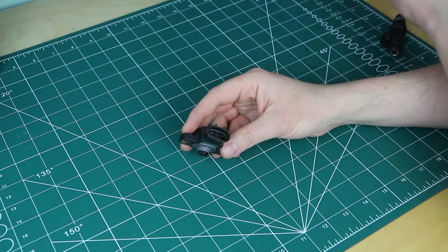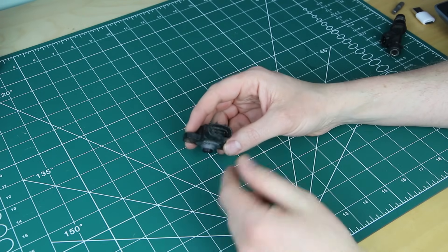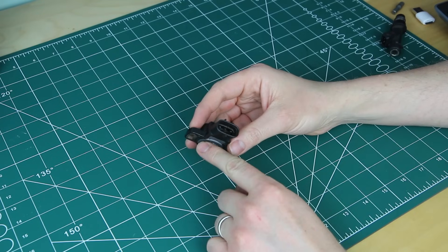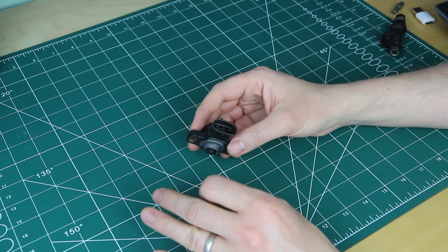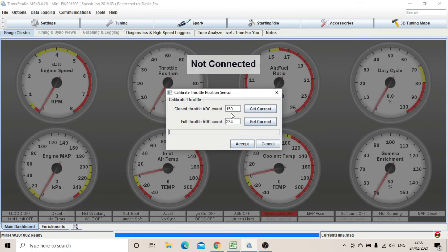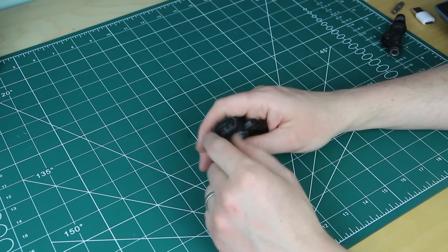If you don't know the wiring, it's pretty simple. The signal is normally the middle pin, but you can find voltage reference and earth because their resistance doesn't change when you move the throttle spindle. Earth is the one with the lowest resistance to signal when the throttle is closed. All aftermarket ECUs have a TPS calibration mode — one reading closed, one wide open. If the value goes down as you open the throttle instead of up, you've got voltage reference and earth swapped — swap them over and you should be good.